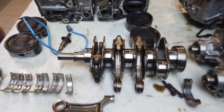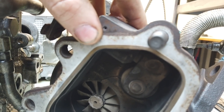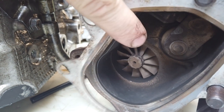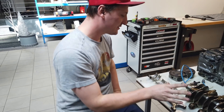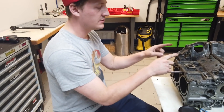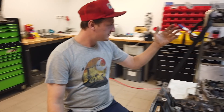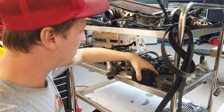The crankshaft is damaged too — we have bigger scratches here and we still need a new one. There's a fat crack on the turbo as well. So we need a new turbo, possibly a new head, a crankshaft, and the rods need to be checked and measured. We also need to bore and hone the cylinders and do a head stud conversion, and check the main journal.